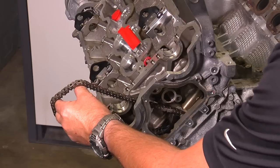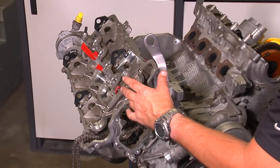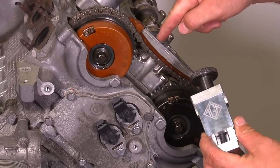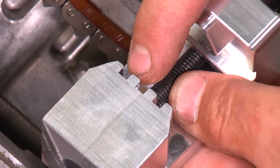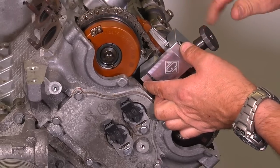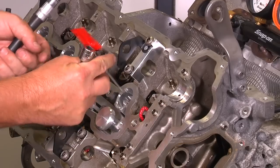It is preferred to turn the engine just one or two degrees past TDC to prevent the engine from rotating backwards once we apply air to the cylinder. Insert the chain holder onto the opposite bank with the triangular pattern fitting into the chain guide, making sure the teeth are aligned into the notches on the timing chain. Tighten the knob gently by hand — do not over-tighten. Remove the flag.